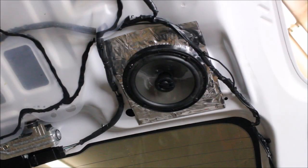Another thing I like about the C2s is they don't require a lot of power to run. There are some speakers out there that if you just run them off the head unit they're not going to sound very good at all. The nice thing about this speaker is if you just upgrade the head unit and need a speaker replacement because yours are blown, you can drop in the C2s and they'll sound good. But later on when you have the money and want to amplify them, they can handle it and they really come alive when they have more power.